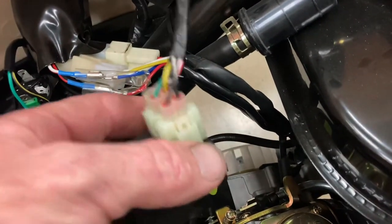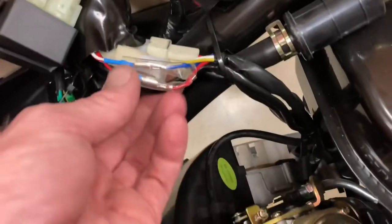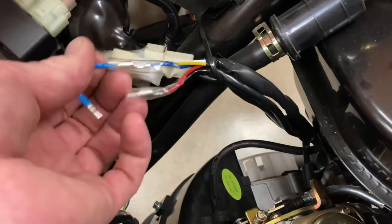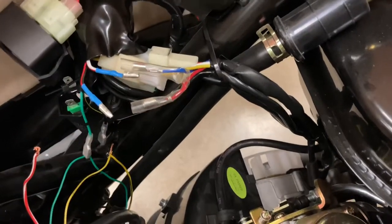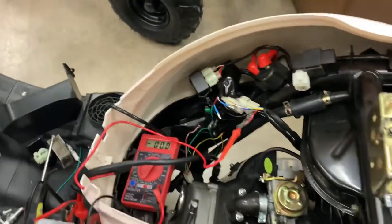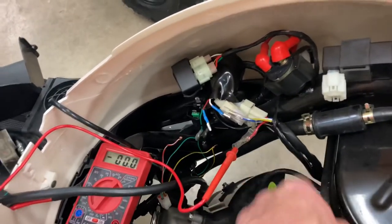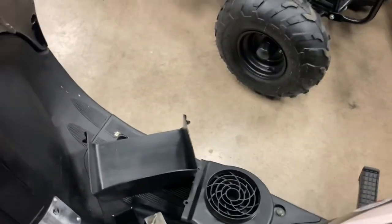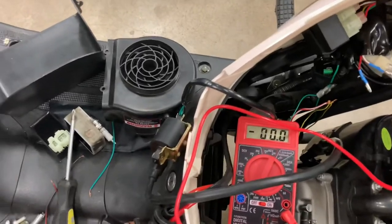First thing I can do — these are your trigger and your high voltage cables that come in here. Let me get a volt meter and show you. We're going to check the main voltage here — this should be over 50 AC volts. I've got my black and red wire coming straight up from my stator and got everything hooked up. Let me check this with the kill switch. Hold on.